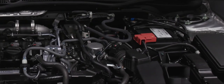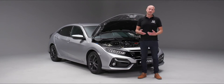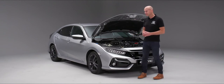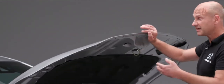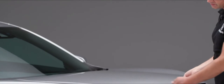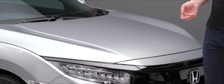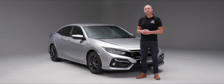We do have a 12-volt battery just on the right-hand side of the vehicle. Once you've checked the fluid levels under the bonnet and topped them up with the appropriate fluids, remove the bonnet stay, click it into place, and close the bonnet from a relatively shallow height — just let it close under its own weight. From a maintenance-at-home point of view, those are the key items, but your Civic will also need regular servicing — the schedule is 12 months or 12,500 miles.